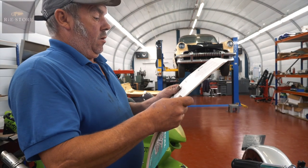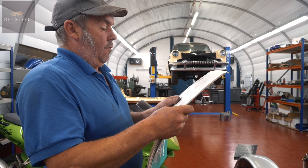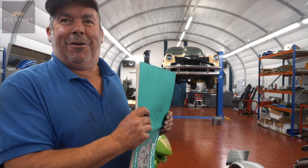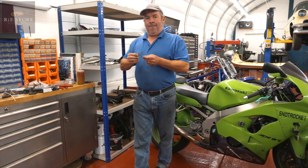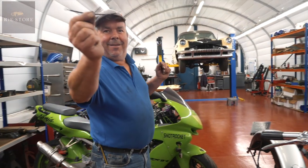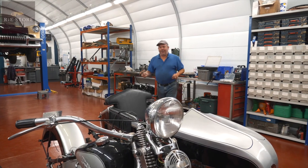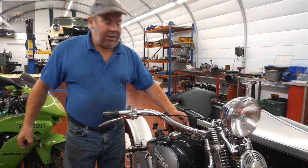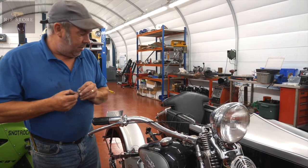So number six, I've forgotten to put a wire in, because there's not four wires going to that, there's five. So I'm definitely going to have to put a longer bit of wire, a longer bolt through there. It'll be that one out of the wiring loom kit then. That's what it's for, huh? Because that terminal post that I put in there, see, that's half the battle. I'm not used to doing a big twin at all. This terminal post feeds everything. Right. Which it doesn't on a WLA.